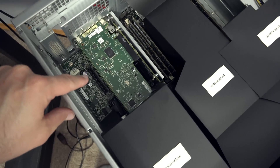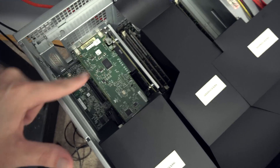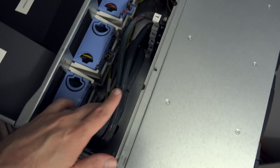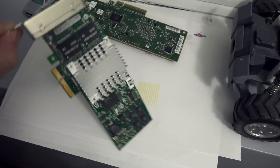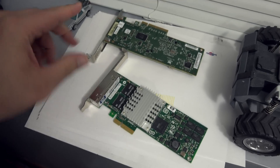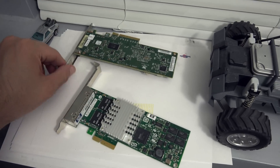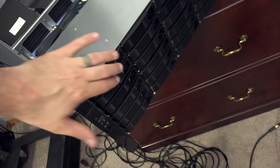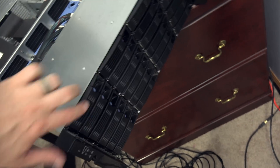Right now I have this port completely freed up. I know I just said they're all full — however, these two here are actually two RAID cards that connect all the hard drives up front. This is actually a four-port Ethernet card I'm using to get temporary connectivity to the server so I can manage FreeNAS and test things out. And this is the third RAID card that manages the top layer — it actually manages the top two rows of drives.